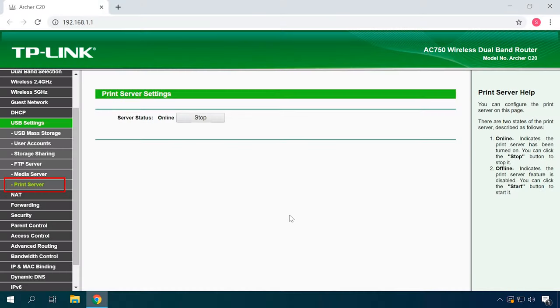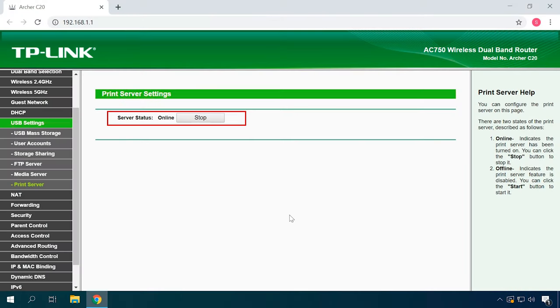Connecting a printer to the router: you can see there are settings for the print server, meaning you can connect a printer accessible by all devices within your network. Let's have a closer look at how to connect a printer to a router with a USB cable. This method has certain advantages over using a shared printer — the printer will be connected directly to the router, and there is no need to have a computer running all the time in order to print. To begin, turn off the printer and the router. Plug one end of the USB cable into the printer and the other into the router. Turn the router on, and after some time, turn the printer on as well. Go to the web interface of your router and open the tab USB Settings – Print Server to check if the connected printer is displayed here. The server status should be online — if it's offline, click Start. If the router is unable to recognize your printer properly, consult the user manual for the router, as your printer model might not be supported.